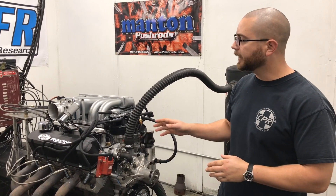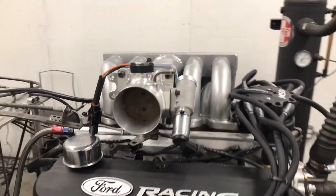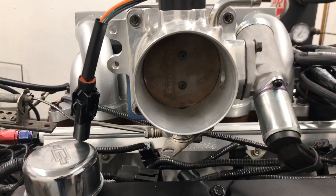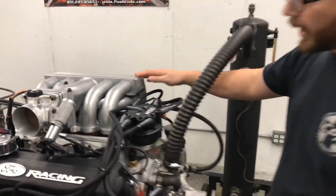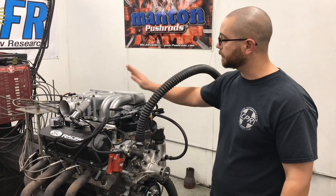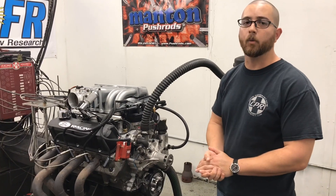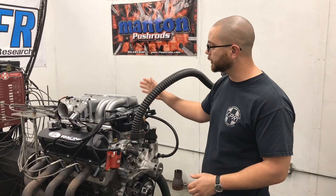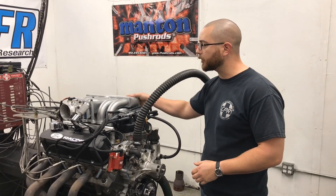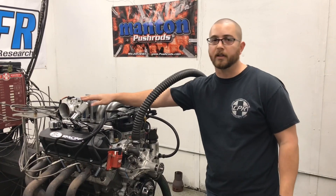In this series of tests, we're actually going to test different intake manifolds. We're going to use the GT40 lower and upper. This is actually one of my favorite looking intake manifolds — the tubular GT40. Right now it has the stock lower, so it hasn't been ported. The second test will be the same GT40 tubular upper with the ported lower. The test after that will have the Explorer upper, which is pretty close to this tubular intake — it may have a little more plenum area, so we'll see if that makes a difference. And the last test is going to be a Holley Systemax intake. All of these are going to be tested using the AccuFab 75mm throttle body to keep everything consistent.